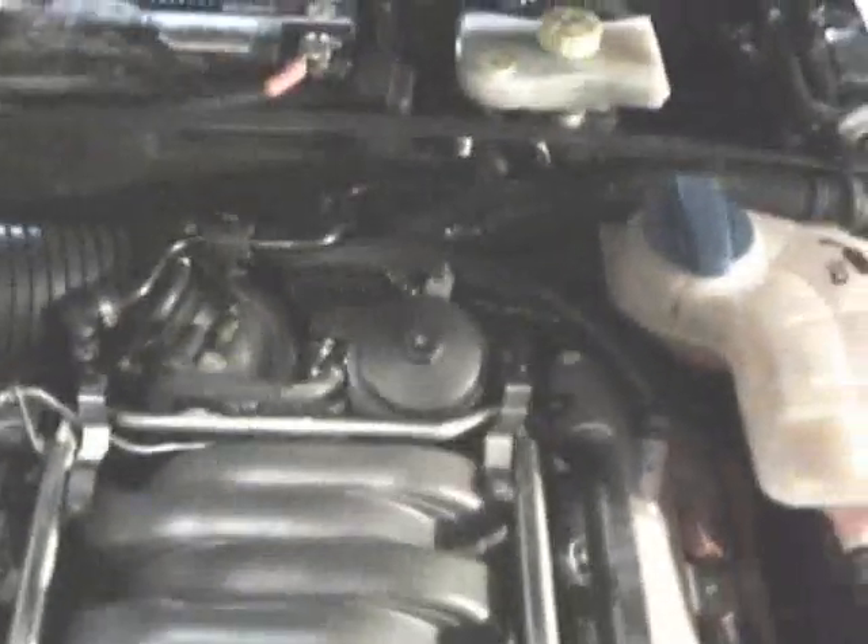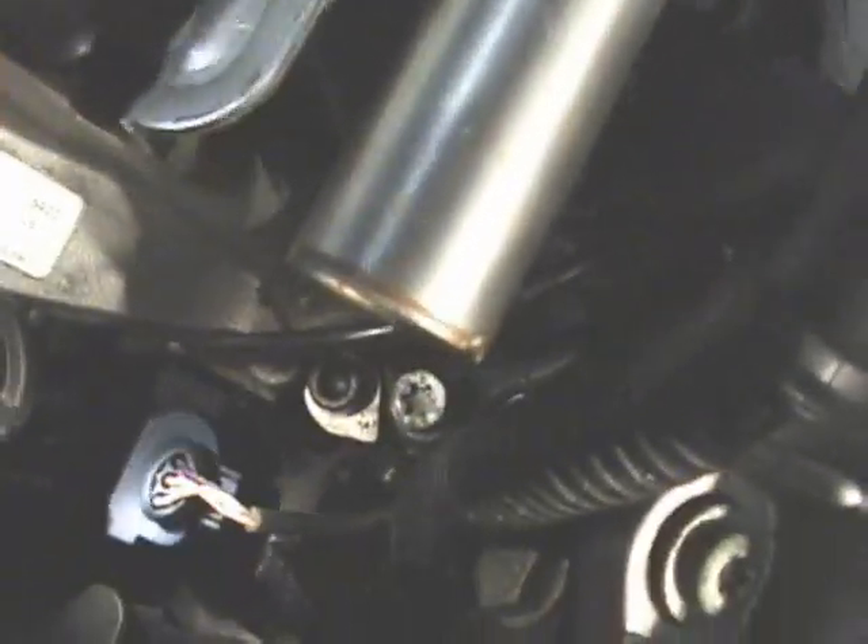Once you get those off, the intake manifold should be easy to move around. You'll pick the manifold up near the back and lift it over the oil filter a little bit, then unhook some more connections up here. There's a large vacuum line about a quarter inch in size near these connectors. If you hadn't undone these connectors already, you won't have a lot of slack, so you can probably unplug them at this point. Slide them out of their metal brackets.